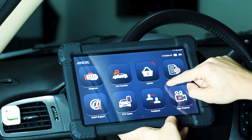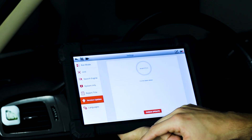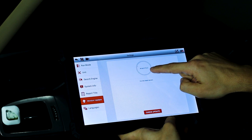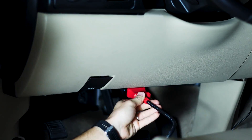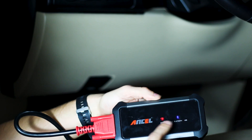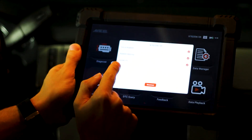The first thing I want to do is connect the Wi-Fi. Then slide to the right, go on settings, version update, and go ahead and update the tablet. As of recording this video, it's on version 12.2 - I got the tablet at version 10. Now let's go ahead and connect the unit to the car. In the Tahoe, the OBD2 port is right down here. It plugs in just like that. It already has power and the Bluetooth is also turned on - it has automatically connected to my car.